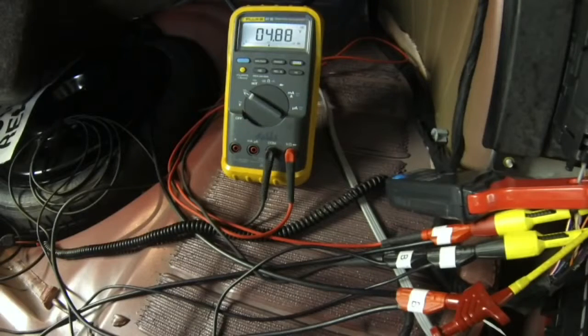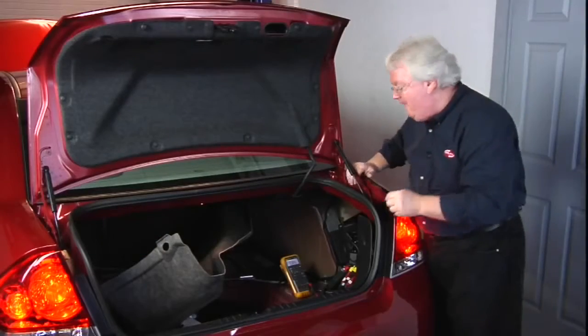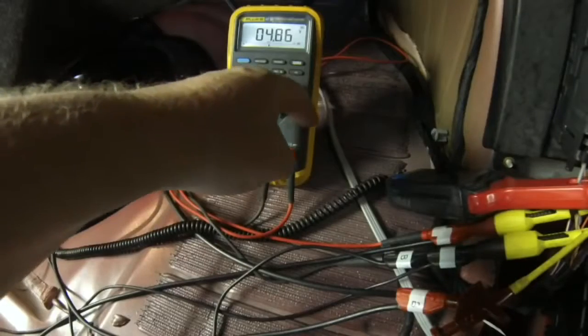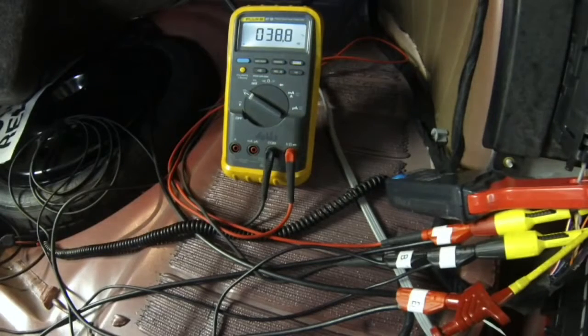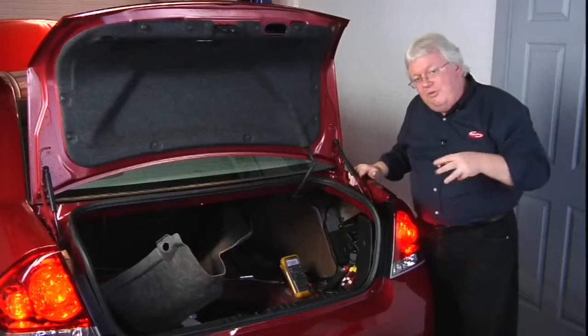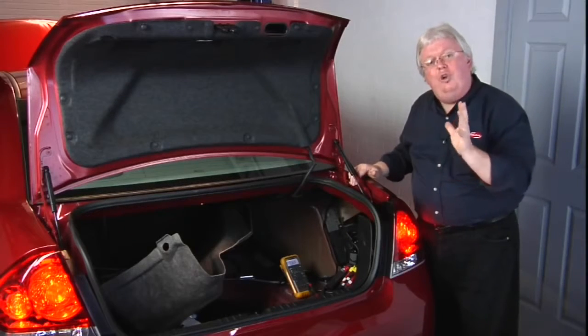But this is very fast. If we just look at the raw voltage averaged out on the multimeter, I've got about 5 volts — meaning we don't have a voltage drop, we have a duty cycle that's off and on. Let me turn the meter to duty cycle. We're on about 38 or 39 percent of the time and off the remainder. So that's why I only have about 5 volts. That's normal.